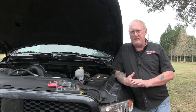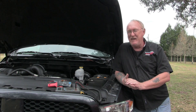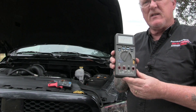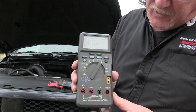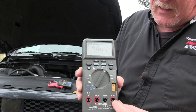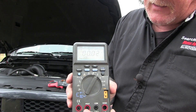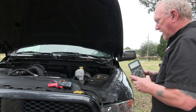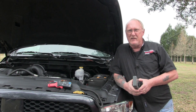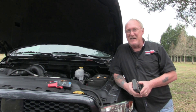What do you need to do current testing? First, you need a digital multimeter that has an amperage function — that's all of them. Make sure when you use it that you place the leads in the right place. When using it as a voltmeter, your ground goes in the common terminal and your red lead in the voltage/ohm terminal. But for current flow, you've got to move that red lead to the appropriate amp terminal. These are fused internally — if you make a mistake, you'll pop that fuse, and odds are you don't have a spare, the tool truck isn't coming for a week, and the store is 30 miles away.